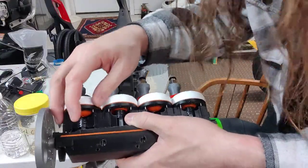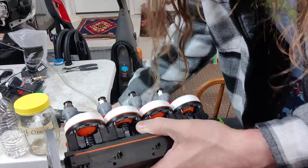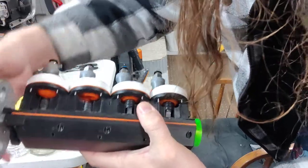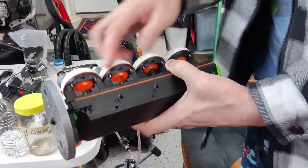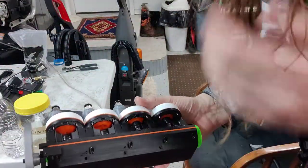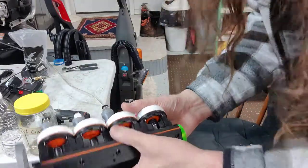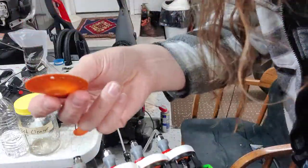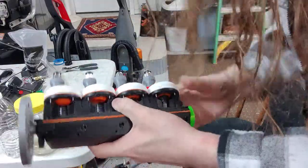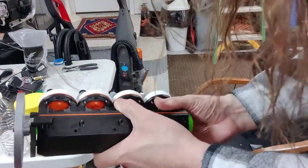The other reason why I do the single heads is so that when I'm pushing these diaphragms, sometimes you can mess up and overextend them or overheat them and warp them, causing them to have a bad design — like this one right here, which doesn't retain its shape very well. By having a single diaphragm across the entire head or a single head for multiple cylinders, if I made a mistake I had to reprint the entire gasket. Now I have individual diaphragms for each head, which allows them to be replaced individually if they wear differently.